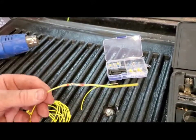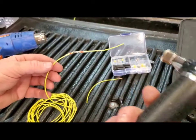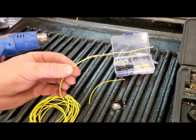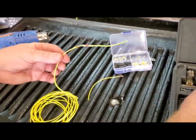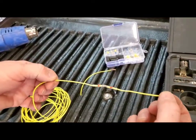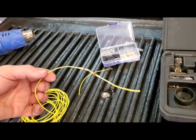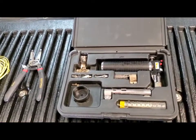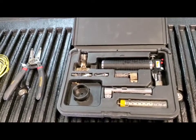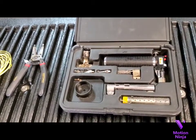The easier way is to go with the heat gun versus the butane torch, but I find myself grabbing the butane torch because it heats quicker and seems to get in there really well. Anyway, that is a solid connection. Anytime you want to do any kind of electrical connections with your wiring harnesses, this is the way to go — I highly recommend it. Subscribe, like, and comment on this video. We'll have many other videos coming in the near future covering all kinds of vehicles on a weekly basis. Thank you.